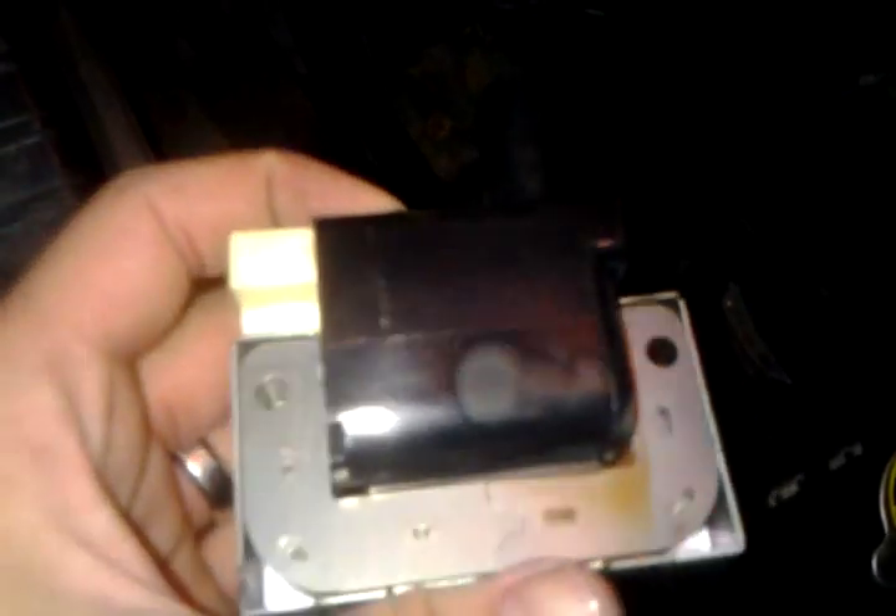I changed these, and it just ended up being a little too much for the old coil. Now, the reason why I knew the coil was bad is it has got burn marks on it, and heat scorching all the way up and down the side here.